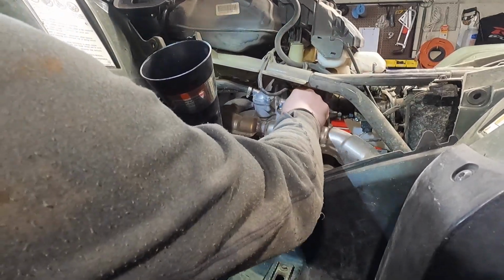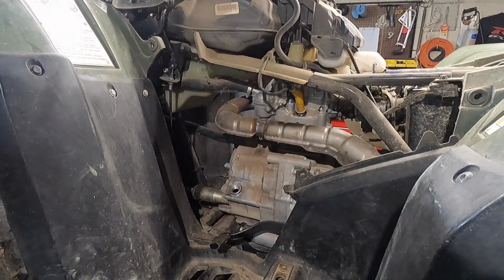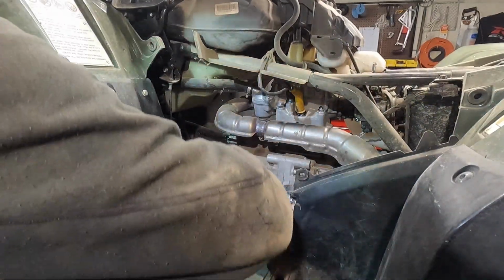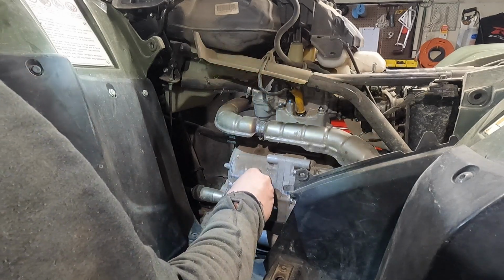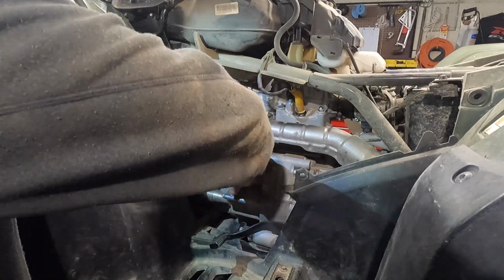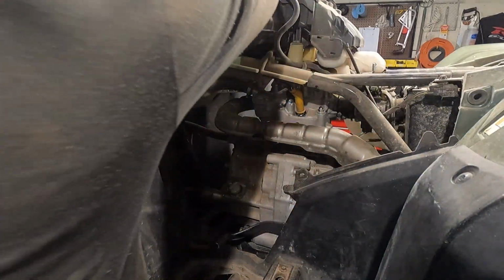All right, let's get this. Make sure that's all the way down on there. Let's get this guy out of here, plug it off, throw that in there, and throw one of my bottles upside down here. Start draining it while we go check the oil height. Let's see. Yep, oil's just a little high. Of course, we haven't ran it through the new oil filter or anything like that, so that's going to play a factor. So, all right, well, let's turn the key on.